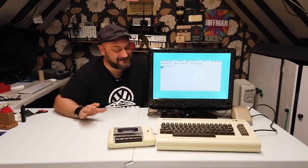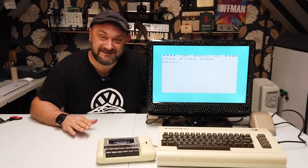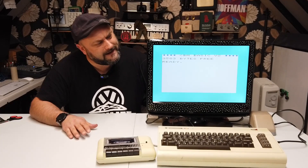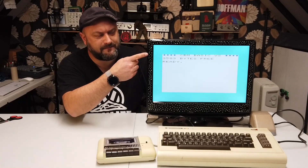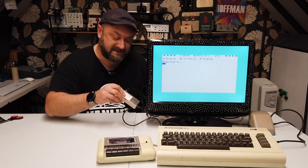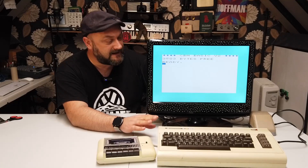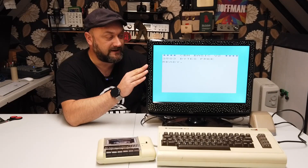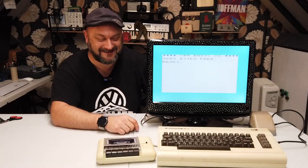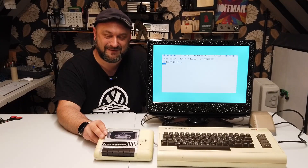I genuinely don't believe it — this is epic! I've never owned or even played with a Commodore VIC-20 before, so this is going to be a lot of fun. I haven't done any research into the machine yet, so we'll get another episode together and have a talk about the VIC-20 — what's inside it, what makes it tick. It looks like it's only got 4K of RAM. The keyboard works, the computer works, and the little modulator appears to work as well — we're running through a regular TV signal right now. It might be nice to add a composite interface. And there's the Commodore VIC-20 cassette player — I've plugged it in but nothing happens, no movement on the cassette and no power light, so there's a bit of work to do there.